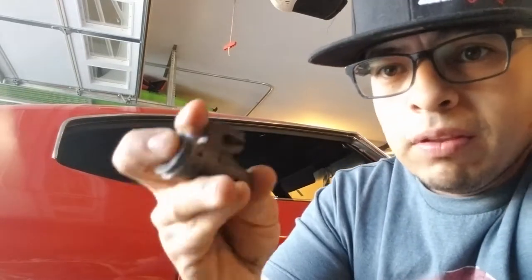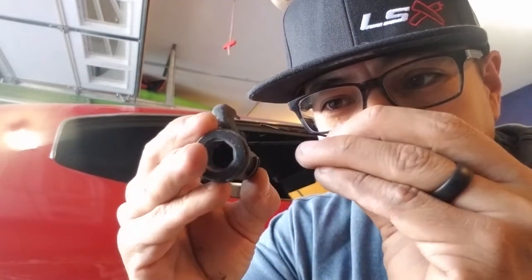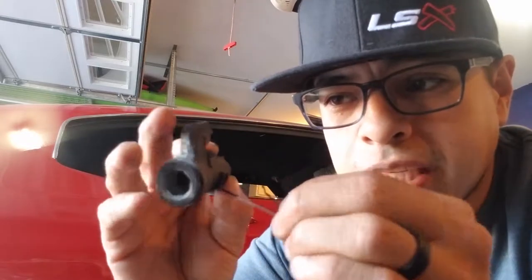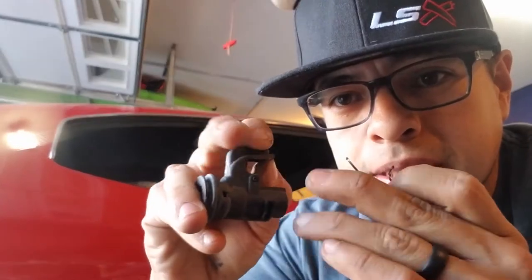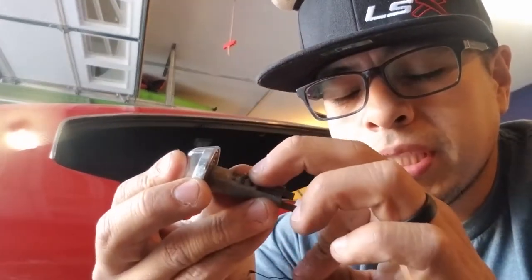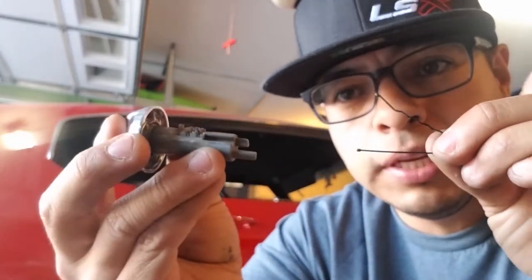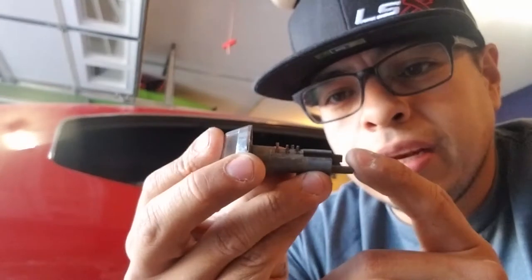What you don't know is that these have a little yellow square right there — I don't know if you can see it. You're gonna stick whatever you can find in there; even a cotter pin would work. I'm using a Bobby pin — I've got a bunch of females in my house. All I did was stick it in here like that, and that'll release it. One tip: you want to have this little latch up in the lock position when you do it. Then you stick the pin in and push the tumblers down one at a time, pulling it down, and it'll pop off once you push down the last tumbler and actually come out.